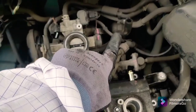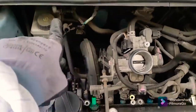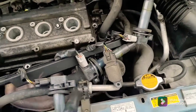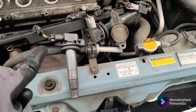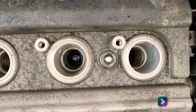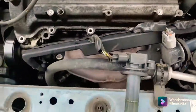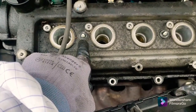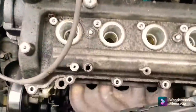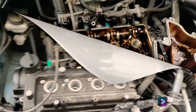I've taken all the screws off — moment of reckoning. I've moved the pipe off to one side and the other pipe out of the way. The coil packs are sitting here and I've decided to leave them in position so I don't forget the sequence. This is also a good opportunity to check the spark plug wells inside for any oil residue — and it's all nice and dry.